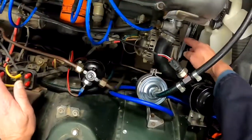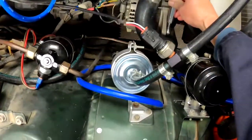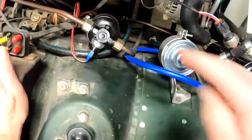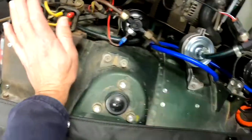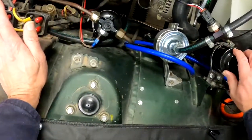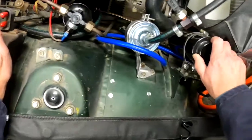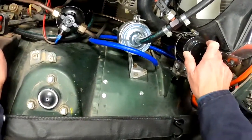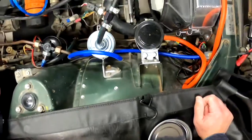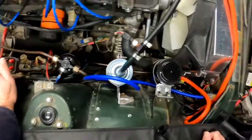This is the most simple upgrade for my alternator. You only have to change out this plug and then install the new alternator. The year model was a 1985 300ZX alternator at 70 amps, so you get an extra 10 amps over the stock 280Z.